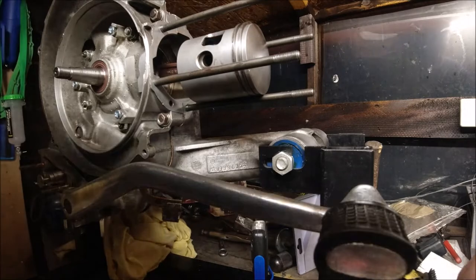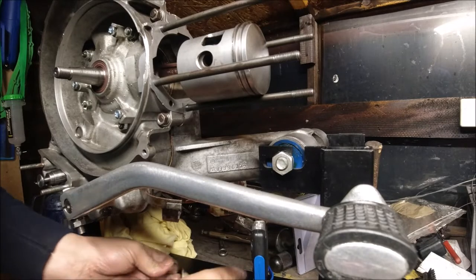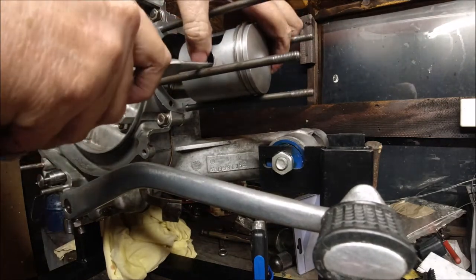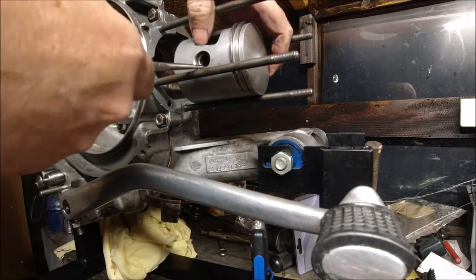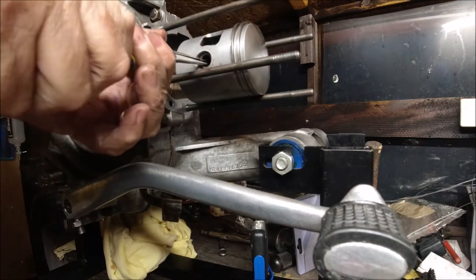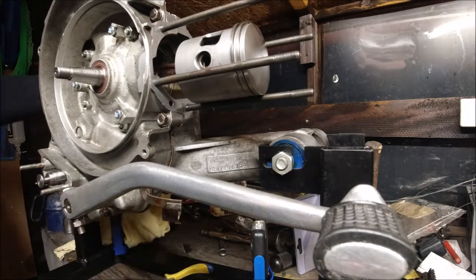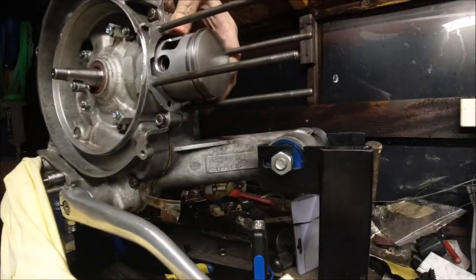We've got play there. Now I'll show you how I get the circlip in. You just push the open end in while rotating the circlip and pushing it in — that's actually in, but I like to rotate it so the pin is pointing upwards. You don't have to; it's just me. And that is our piston in, so use the kickstarter to bring it all the way back.